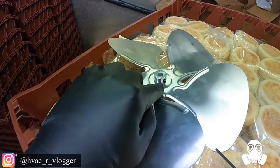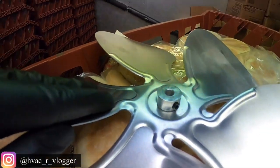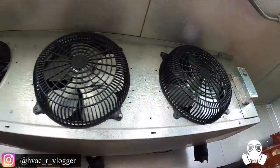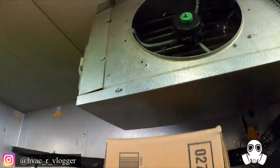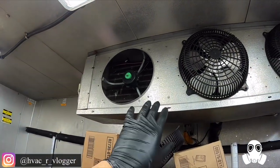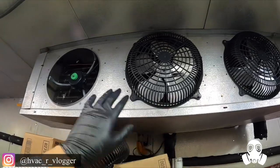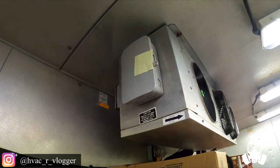I didn't notice, but the one they sent me was the wrong one. This one has an allen key — you guys can tell — and this one's a threaded one. That's the difference right there. I don't think I have any of those in my van. So I'm going to go ahead and wait on that and check the rest of the freezer, because it shouldn't be at 30-something degrees right now even with two fans running and one missing. There's definitely an issue.